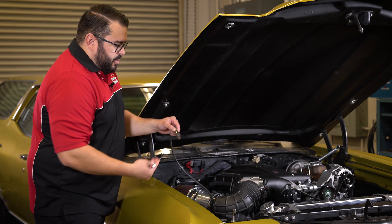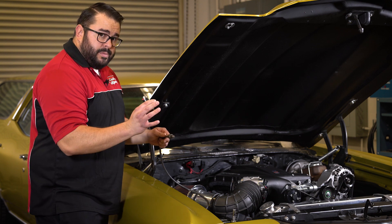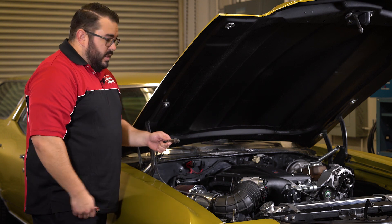That's it — this is really just a simple go/no-go test. If the sensor warms up and reacts to the butane, then your sensor is good. Thanks for watching, guys.